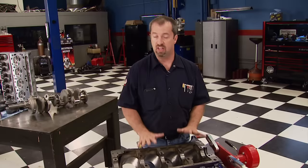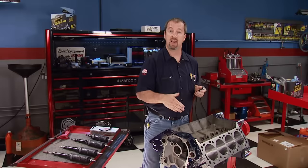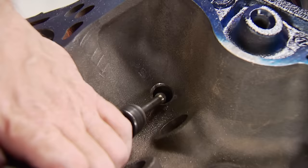These have been known to handle up to a thousand horsepower and last while doing so. The 460's oiling system is similar to that of a 351 Cleveland, meaning it oils the passenger side lifter bank before it oils the mains. But that will be sufficient for us in the RPM range and power level we're going to have. A little radius work and light deburring on the drain backs will satisfy our needs.